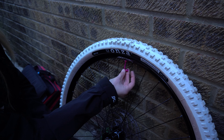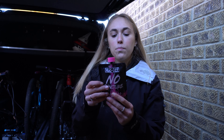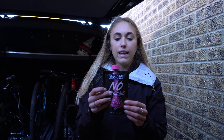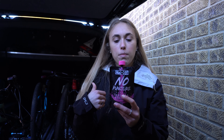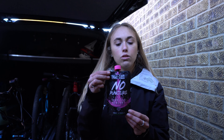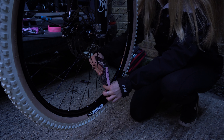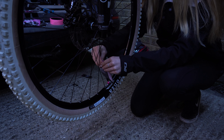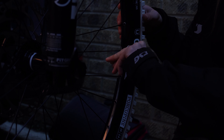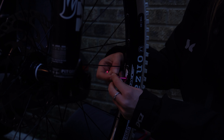I'm glad it happened for this video. Now I'm going to take the valve core out — this handy tool comes with the tubeless valves. You hook it on and spin it, and wow, that was so easy. So we've got our No Puncture tubeless sealant, and on the back there's a guide: for a 29-inch MTB wheel it says to put in between 105 and 140 ml. One of these pouches is 140 ml, so I'm just going to squeeze the whole thing in.